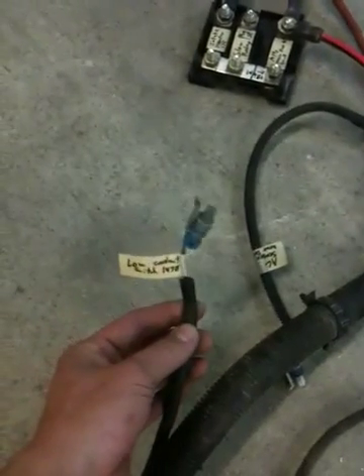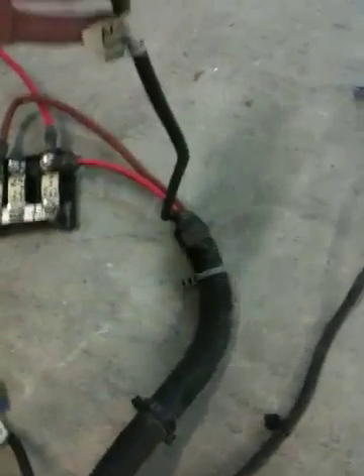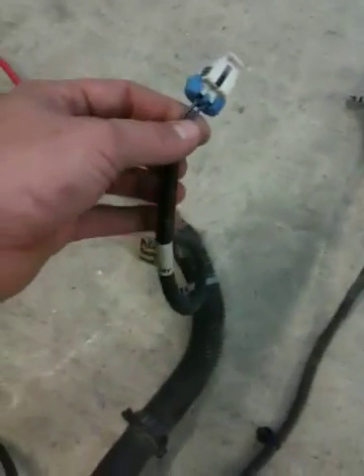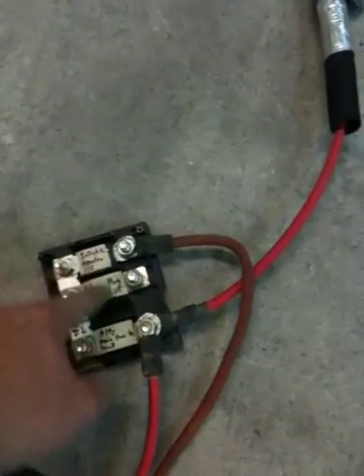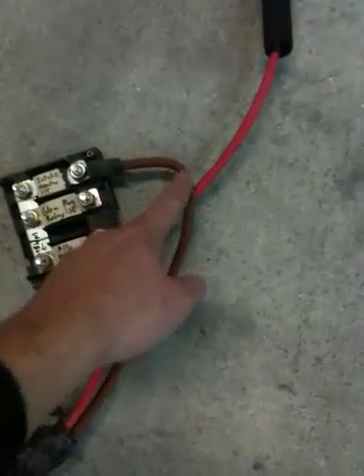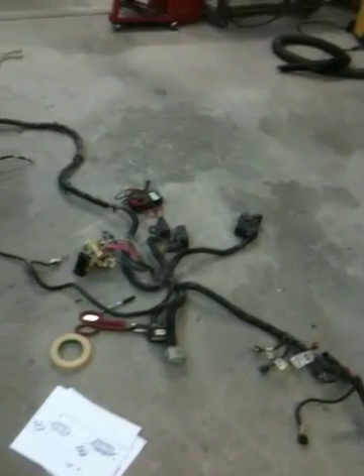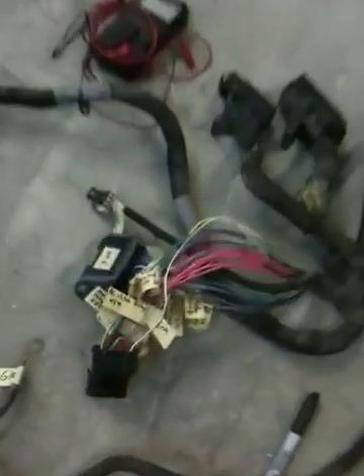I am taking out the intake heater as part of my complete DPF delete. I can also take out that lone EGT sensor that's on this main harness. I'll be taking out the low coolant switch because I'll let the low coolant warning be handled by my donor vehicle. Same thing with the AC low pressure switch — that will all be controlled by the donor vehicle HVAC. I'll be using this fuse module because it's nice and has appropriately sized fuses, but of course the intake heater grid one will come out and this will be repackaged differently. I will not be using the lead that goes to the UBEC because I'm not going to be using the large GM fuse block — we'll just make our own relays to control all the functions we need and switch on and off these pink wires and whatnot.